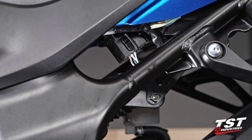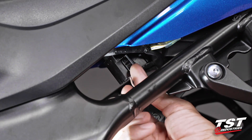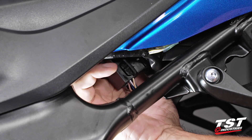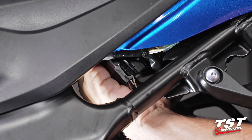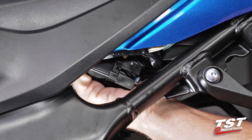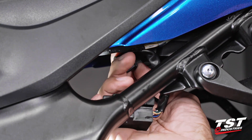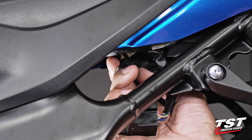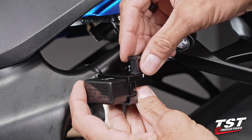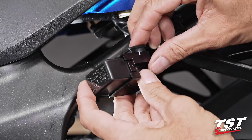Let's identify the location of our relay. It's right here — it is hanging on a rubber suspension piece on a subtray tab that's made of plastic. I like to grasp it and pull it down, rotating towards the ground. It clears it out, but often times I will lose my suspension rubber here, so I have to take that with this assembly and reassemble it.